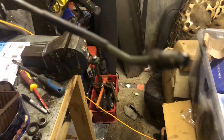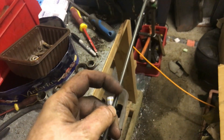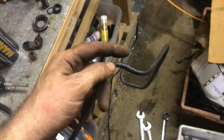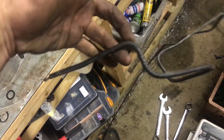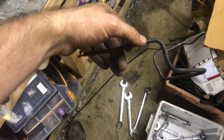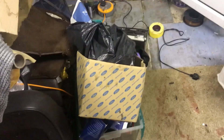Most of the line is really nice — the bit that bolts right under the middle of the car is still in its original green paint and doesn't even have any corrosion on it. Most of the rest is still in its original lovely green paint, so I'm not going to bother remaking the whole line. I'm just going to remake this end which comes up through the rear wheel arch. It's covered in plastic, so I'm going to remove the plastic and see how far the rot goes back, then join it and make that rear end. I'll paint it all green.